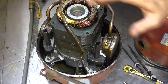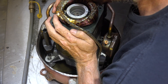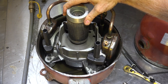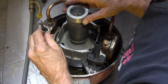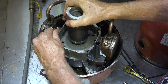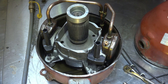I'm going to pull this stator winding off, taking the wire connections to the can out so we can get this off. All we've got left now is the compressor. One of the things I can see right off the bat is that the through bolts went right through here — that's the bearing right here and it's locked up solid. So our problem with this thing had to do with this single bearing getting locked up.